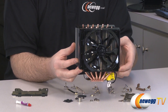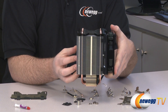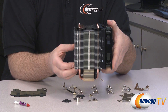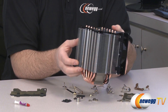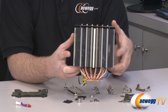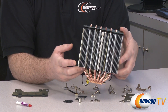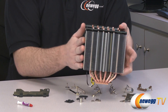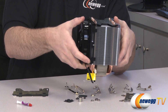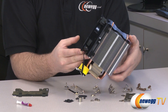Here is the Hyper 612. This is a sizeable heatsink fan, so double-check those dimensions and make sure you have room in your computer case and clearance on your motherboard. One reason this cooler is so big is that the spacing between the cooling fins is wider than you might typically see. That allows air to flow over it more easily, so even at a low fan rotational speed you'll still get plenty of airflow across those fins to effectively dissipate heat.